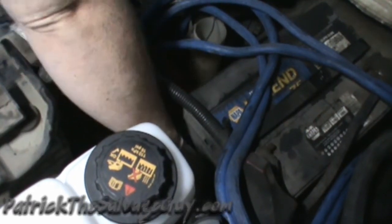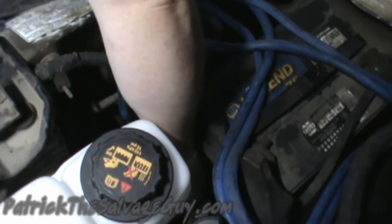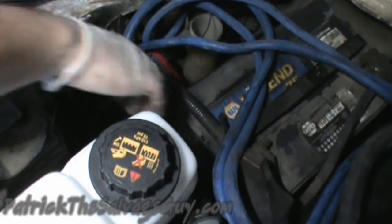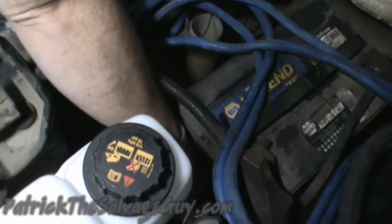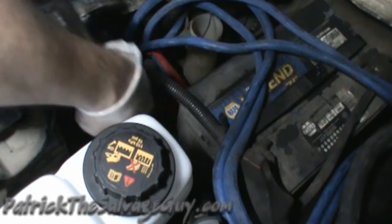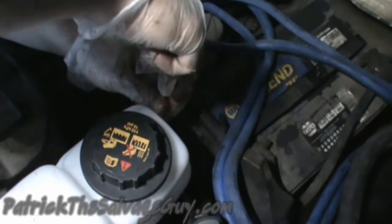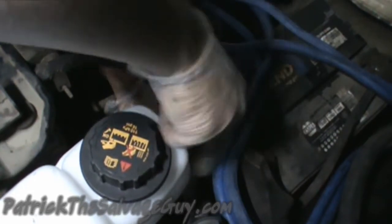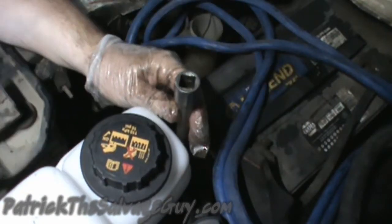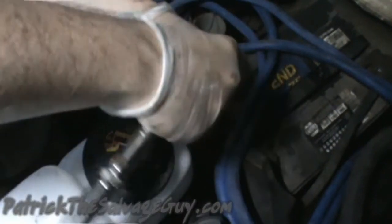Put our bolts back in. And something else to mention before you go through all this, you would also want to make sure that you're not getting diesel fuel into your water. I can't show you an example from this truck, because that's not what was happening, thank God. Because if you do, that likely means you need new injector cups. The problem will only get worse and destroy all the plastics on your truck while it's at it.